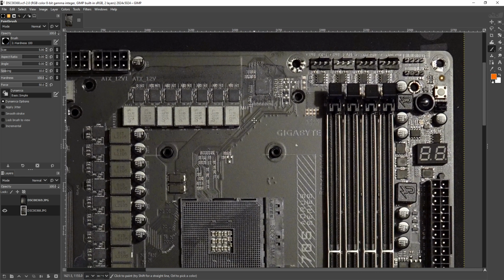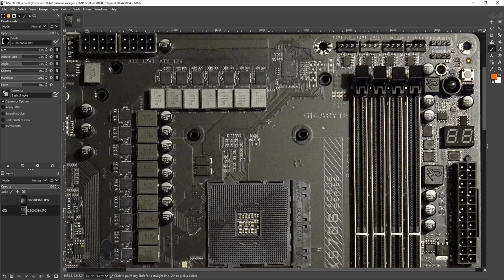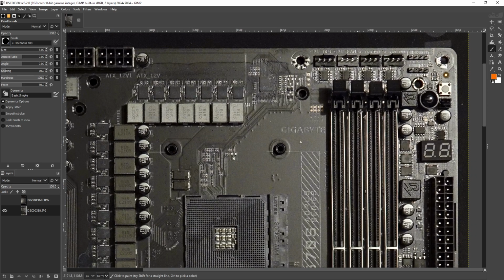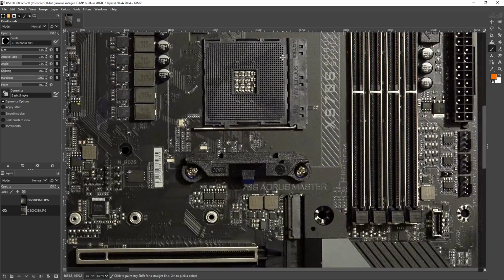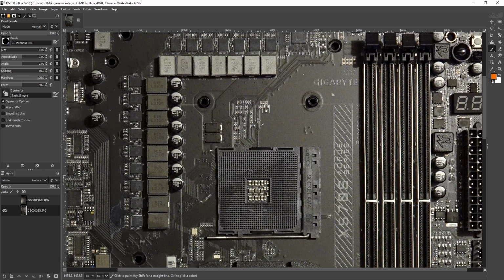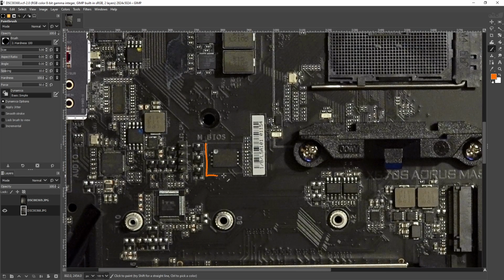Because it's polling the system constantly to read the sensors. Guess what polling the system for sensor readouts does to other things trying to run at the same time. They can't run at the same time. Especially big multi-core benchmarks don't really appreciate having monitoring software running in the background. So in that kind of scenario, the voltage read points can be useful, but you could just do a run where you monitor sensors and another run where you don't monitor.